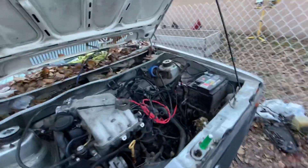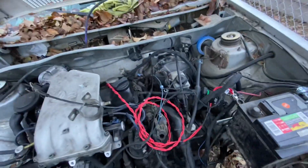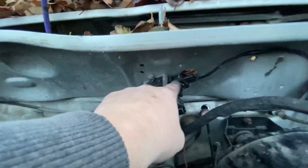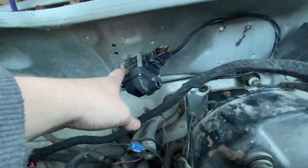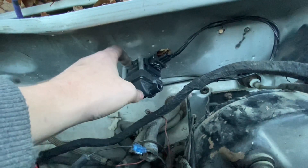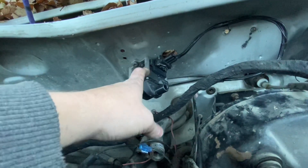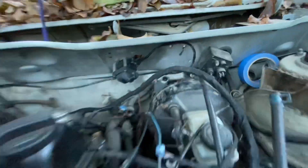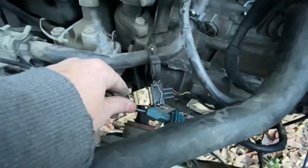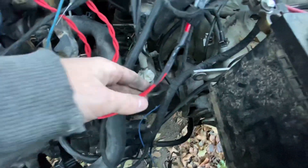Here's the update — got the wiring harness wrapped up, now just trying to figure out where everything goes. Everything is labeled, there's only like four or five plugins left from the harness after you ship it back. This is off a Mark 3, this is what you have to use. Everything's labeled — that says coil, and these are for the knock sensors, this blue wire is for the alternator, and these red wires go to the battery terminal.